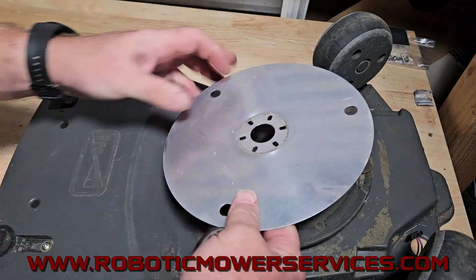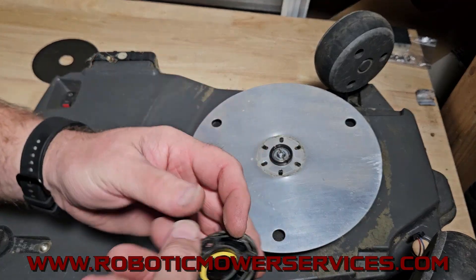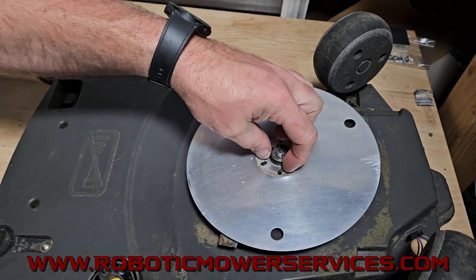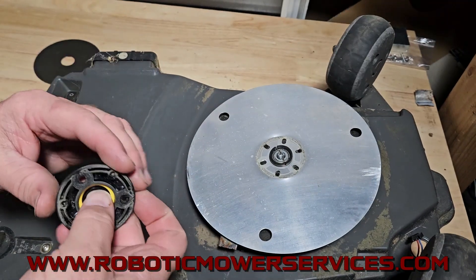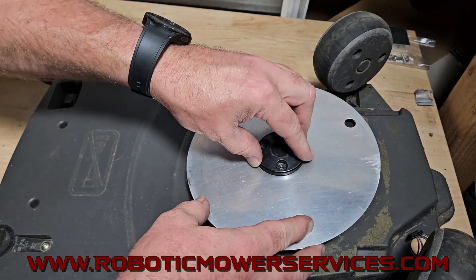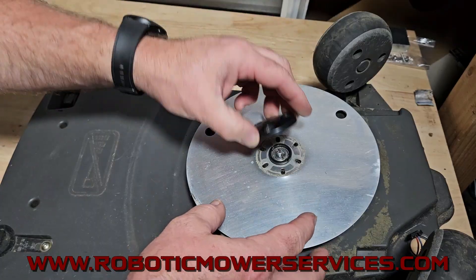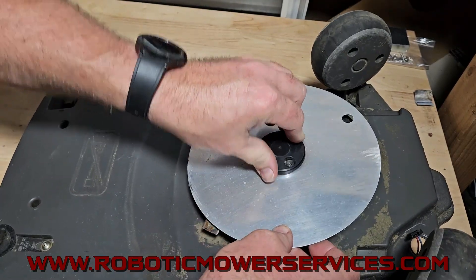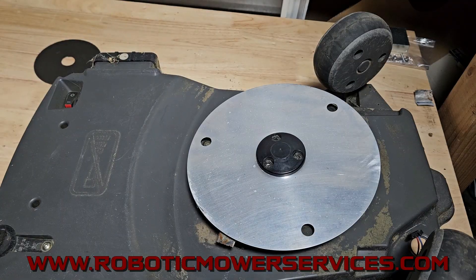You can put the screw back in, tighten it down with your screwdriver, and put the skid plate back on. If you put the cover on there and you didn't go too far — didn't go down to where the skid plate sits — you can put this on there and that will cover up that slot so you're not getting moisture in that area.